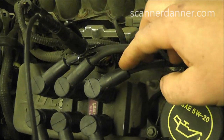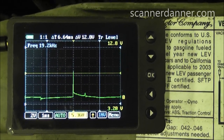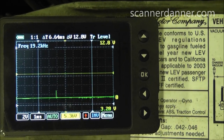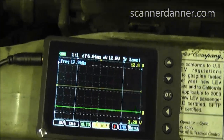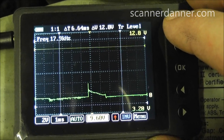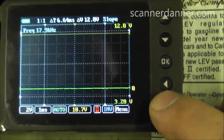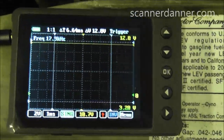Going to cylinder one now — all I'm doing is moving my capacitive lead down the line. Here's your cylinder one. I saw what I wanted to see — that spark line pretty much disappeared. A neat trick with this scope: if I want to catch that event, I'm going to raise my trigger level up to the level we were at on the snap, and then I'm going to set this to single shot. What that's going to do is, when it crosses that trigger level, it'll hold that picture on the screen.